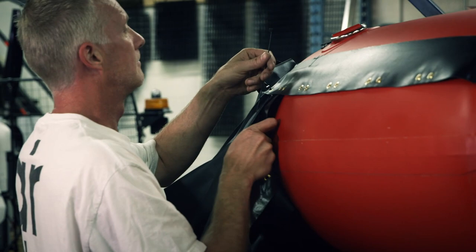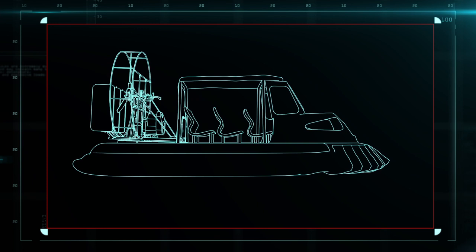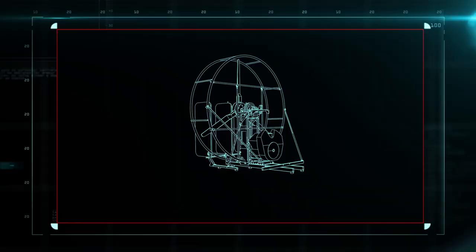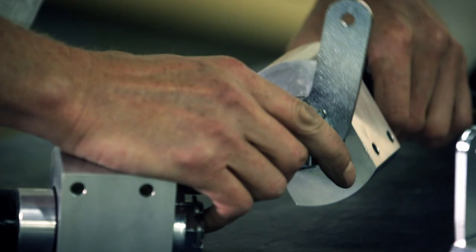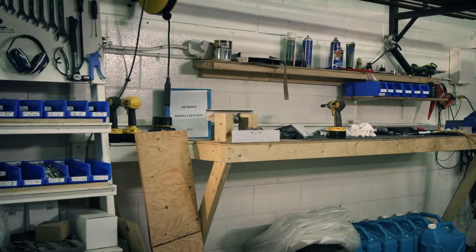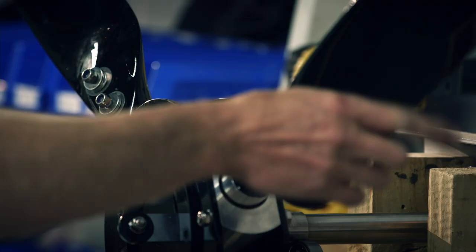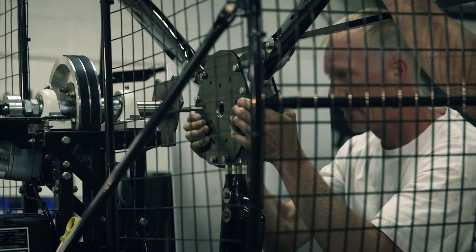Then 16 hollow rubber panels, or fingers, are zip-tied to the bow. When the skirt is filled with air, the fingers create an impact-absorbing curtain around the nose of the craft, making for a smoother ride in rough water. If the fingers get damaged, they can easily be replaced or reattached in minutes. The hovercraft is equipped with a variable pitch propeller system. Gimbals on every blade enable the propeller to pivot and rotate on its axis, giving the hovercraft the ability to brake and glide in reverse. Rotating the propeller on a spindle, the tech checks that all the blades are weighted exactly equally, adding a washer if a blade is even the tiniest bit out — a misaligned propeller will cause major vibrations when spinning at top speed. Once complete, the propeller is mounted in a cage to protect it from getting clogged with debris.